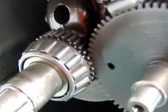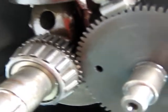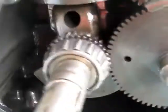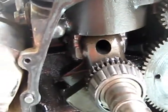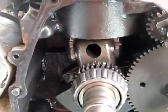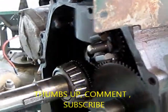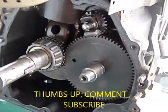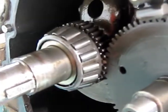I am surprised that it ran five teeth out, but it did. You had to really choke the carburetor to get it to go by hand, and then finally, after a while, it'd sputter and go and it would run, but it had no power hardly. It didn't smoke — that's the gist of this thing here. The timing was way off, and you can't see it down there, but the timing mark is right now.